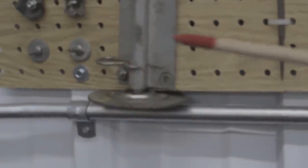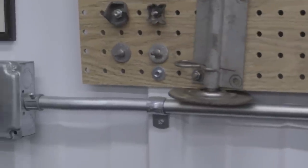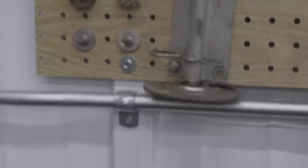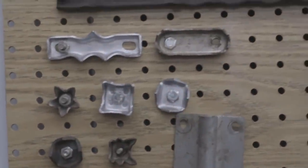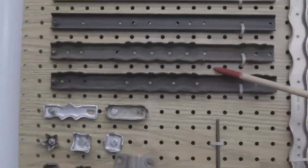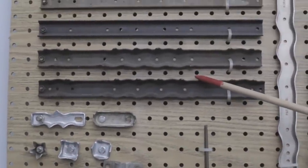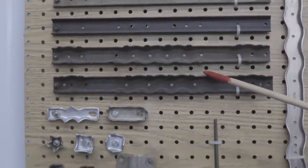Then we used a lot of golf shoe studs and stuff like that, and we put them in our tracks. Then we came up with the claws, the cat claws and stuff like that. And what really set us ahead was this Talonic cleat that had teeth on it. This really helped a lot, especially on our cleated tracks of Polaris and Arctic. Ski-Doo still had rubber tracks, and they had to use these cloth-type studs.